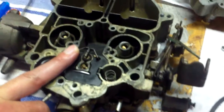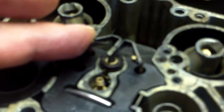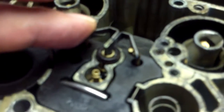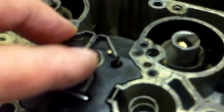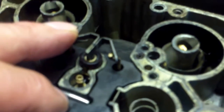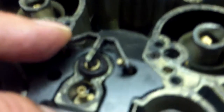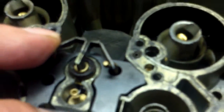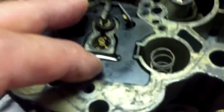I'm having to do this now — this is where I need a third hand, and this is why this little job is so difficult. What my finger is on right now, if you can see, is the primary metering rod assembly. As you can see, it moves up and down in a bore, and there is a spring underneath the piston here. What happens as the carburetor operates is that those rods go up and down — they go directly into the primary jets. That's how the system works: as the thing goes up, the jets are opened and fuel flows.